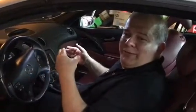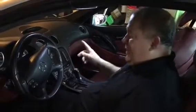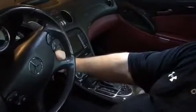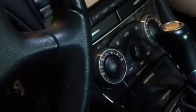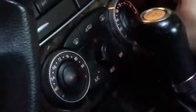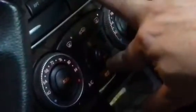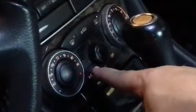So now we're going to start the filling up process, and for that we need to put the heater to open up so you can drain whatever's left in there, so we can do the vacuum and get all the air out as well before we put the new coolant. For that, you come inside the vehicle, you put the keys and turn it on, but not the vehicle, just position A and B, right? Then you put the temperature all the way down, as hot as you can, and turn on the resistance. Don't put it in auto, leave the fan in low.